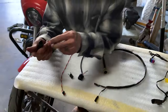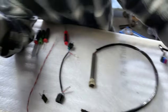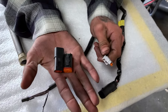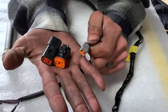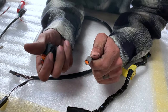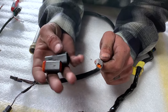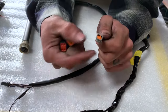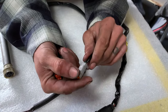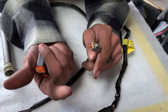If you're on an older Dyna or even on the newer bikes, the headlight plug — these are all the same style. You have a mini Deutsch and then a full-size standard Deutsch. These Deutsch plugs are common on older bikes, like 2000 to maybe 2013 — very common for the hand controls on Dynas. And then there's a two-pin mini Deutsch, like on the factory LED headlight harness for a Softail Lowrider S or a Street Bob.